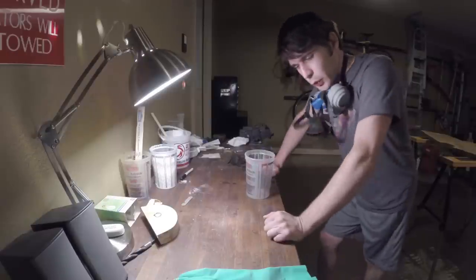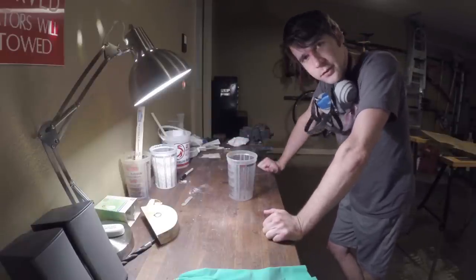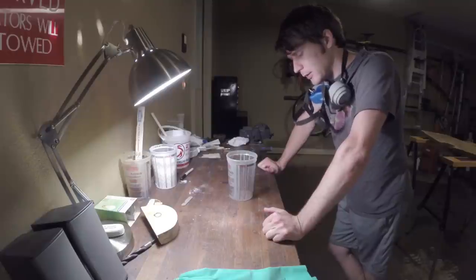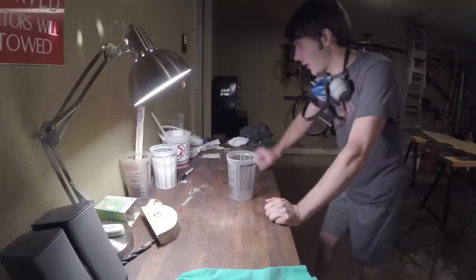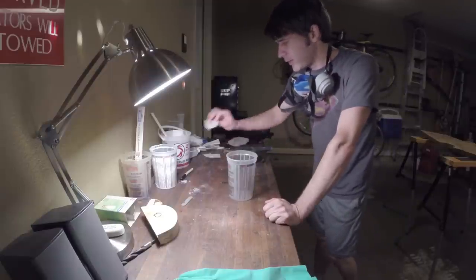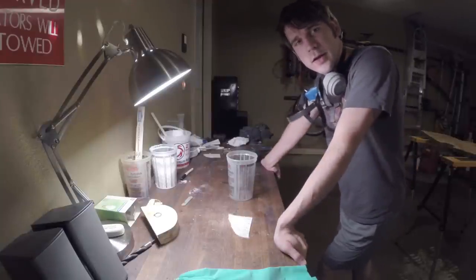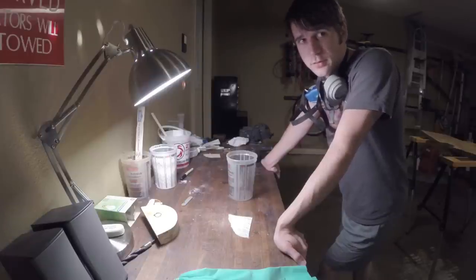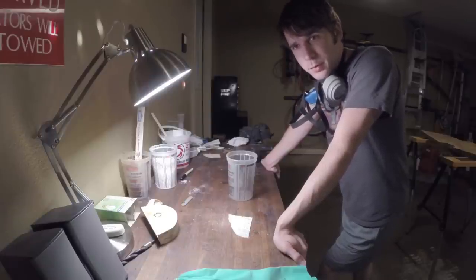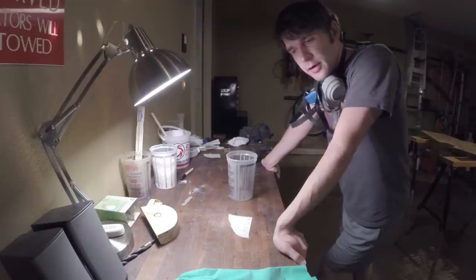Right, so what I'm about to do is mix up some resin, just standard resin at this point. I've got a couple little spots to make a little bit of CSM patches on the transom, and I'm going to do my 1708 patches over the big patches of 1708 on the little holes that I plugged. And that's it. After these all cure, I will be able to actually glue in the transom.